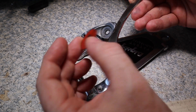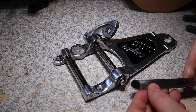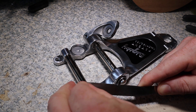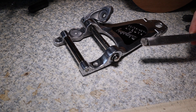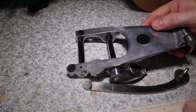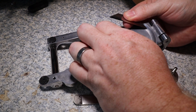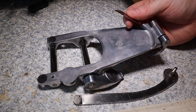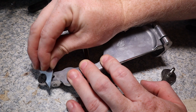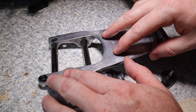I'm also going to remove this fiber spacer that has some grease on it and set it aside. The second step in the process is to remove every single piece of felt on the unit, because I didn't do that the first time and they got a little goopy. The more of these you remove, the happier you're going to be at the end. They will just stick back on if you want to use them. There are three on the underside of the unit. Use a razor blade if you're having trouble pulling them up. We are going to be putting these back on later, so it's best to keep them in a single piece if you can, because they are there to prevent marring of whatever finish you're installing this onto.